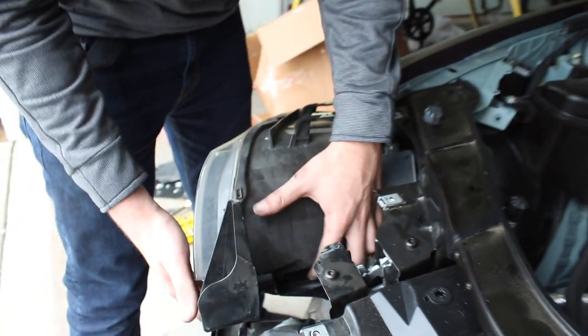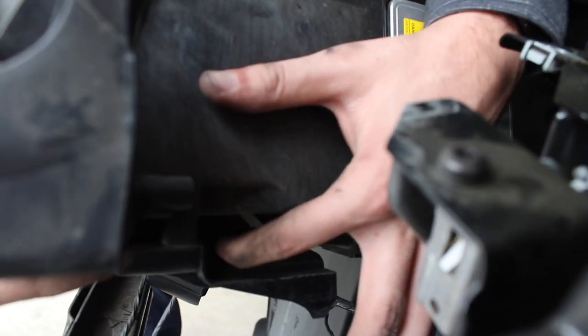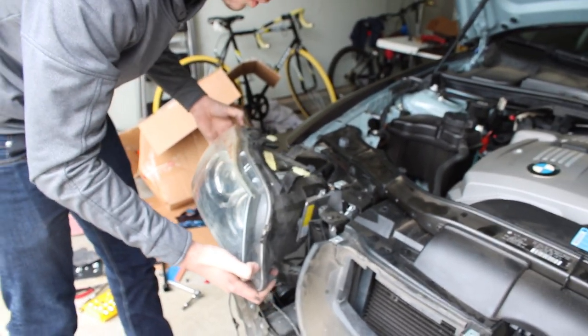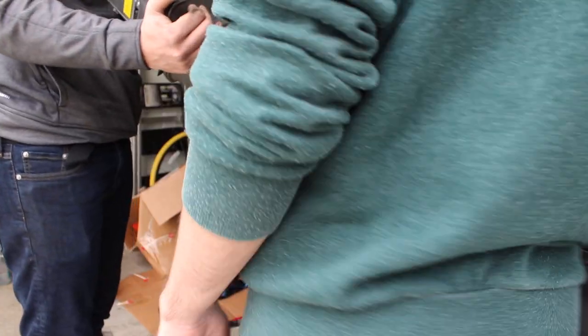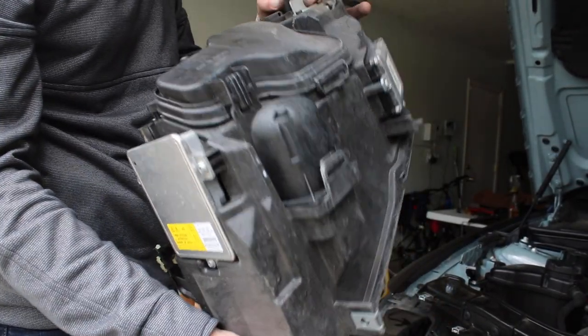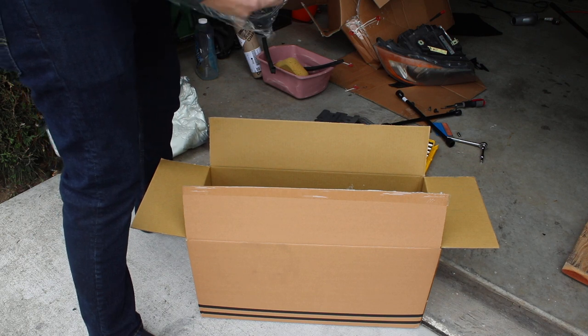The screw hole is down here. You have to remove the headlight with the bracket somewhat out while the cable is still connected, then take out this screw right here — it's a T30. Once you get it out, you can drop it down and pull out the entire headlight. Then you just have the last cables to deal with. My other headlight didn't come with all these extra wires, which is kind of surprising. This is how the headlight looks once it's out — one side done, now we have to figure out how to wire the other one.